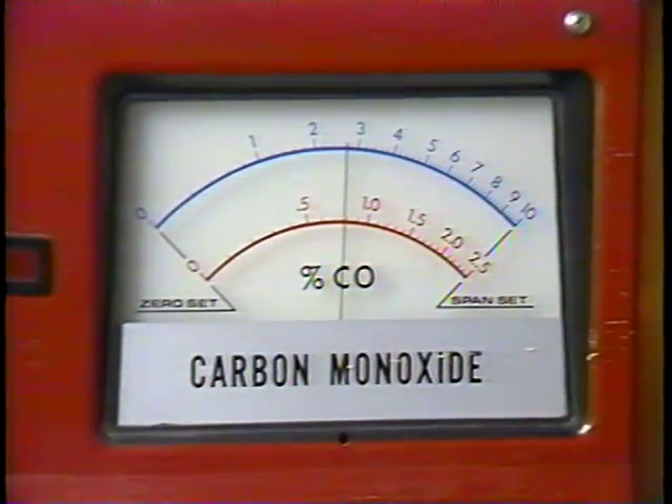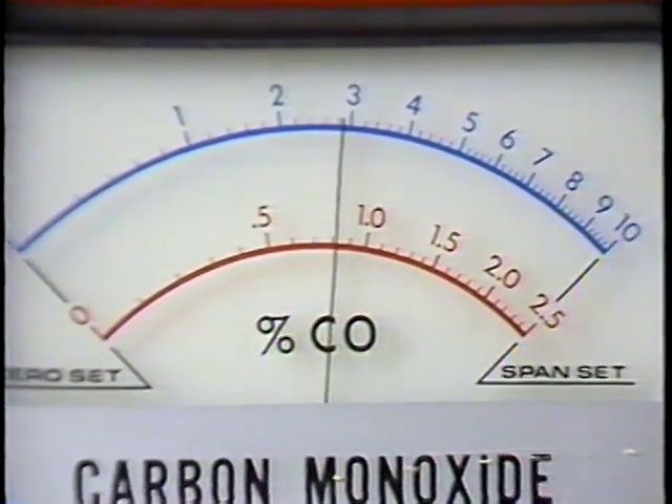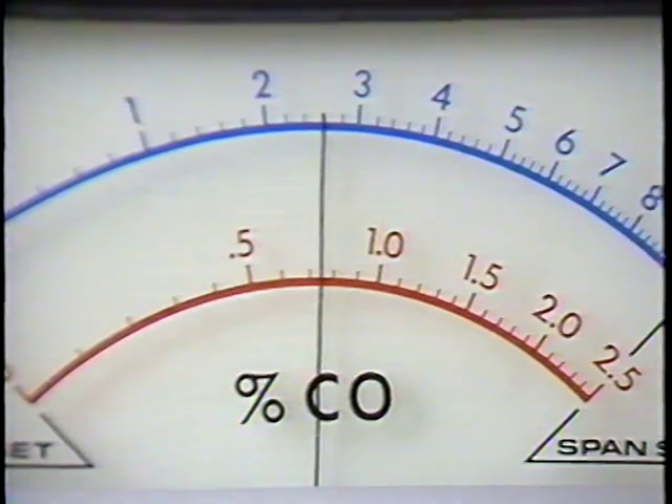The milliamp current could be correct, but the CO might still be off. The car could have a malfunctioning injector or an intake air leak. The important thing is always check the CO percent. Another reason for checking the CO is because you can tell if the oxygen sensor system is operating or not. And it's also a good check for the overall condition of the engine.